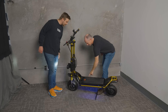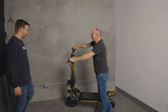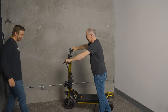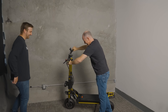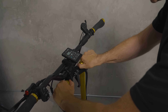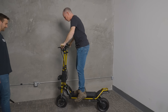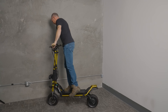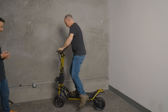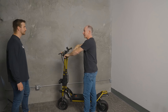I love the swag lights — it's got these blue swag lights. Low beam, strobe, and high beam. It's just funny having knobs to turn. I'm cranking up the front suspension compression damping now and it's got a lot of clicks — yeah, that's firmer. So if you're doing rougher off-roading you want to make sure you're not bottoming out constantly, or if you're doing really fast stuff and hit a lot of little bumps, you can turn it the other way and get a faster suspension response.